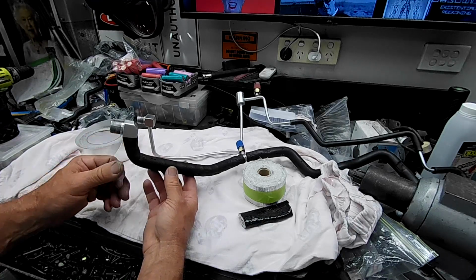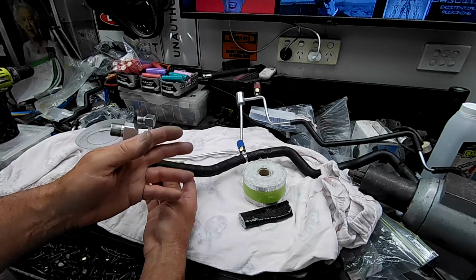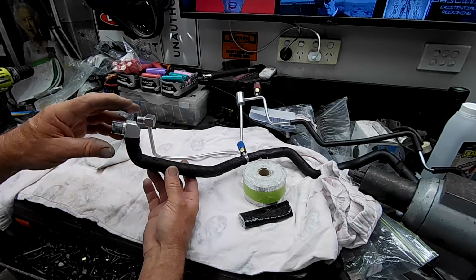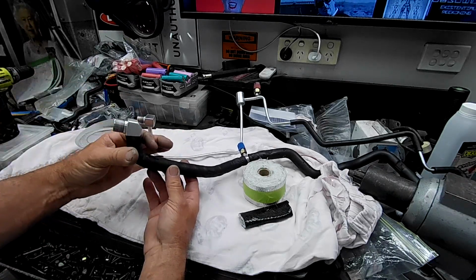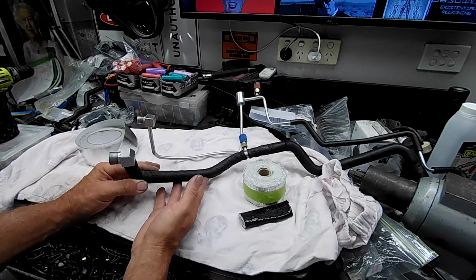And if you use a twin wall, either 3:1 or 4:1 shrink ratio heat shrink, you've got plenty of room to get over your fittings, and then it will shrink down enough to go tight onto things. So that's what I think I'll do with that one.